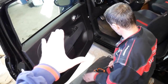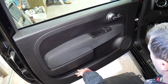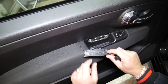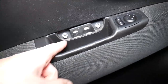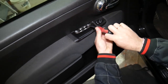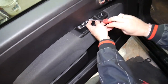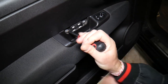To remove the door panel we need to remove a few covers, bolts, and screws. The first cover to remove is right where the interior door handle is — pry that one off and you'll find two screws with an allen wrench. Ours is a 5-millimeter allen wrench. Go ahead and remove both screws — first screw comes out, then work on the second one.